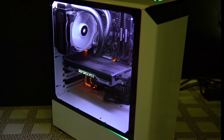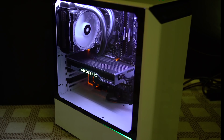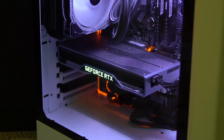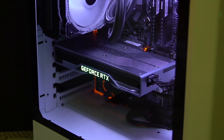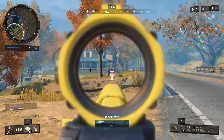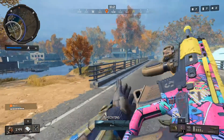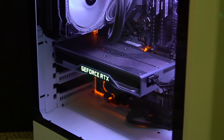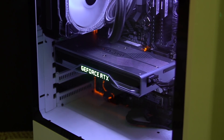Here on the right we're showing the new RTX 2060. This single machine is able to output the same level of quality as the dual PC because it has a brand new encoder in the RTX 2060. It has been improved and can match that quality. It can run the game and stream at the same time because it's using NVEnc — a dedicated area in the GPU that takes care of the encoding — so you offload the encode from the CPU and it doesn't touch the GPU rendering at all.